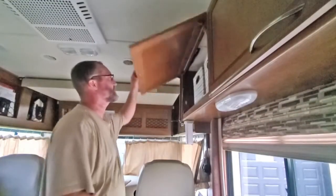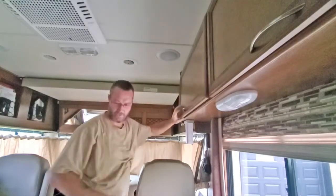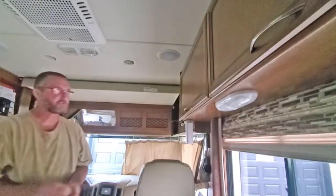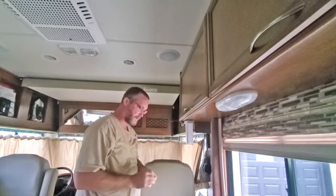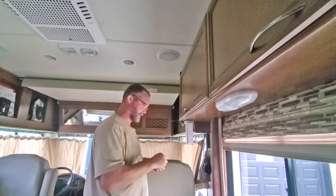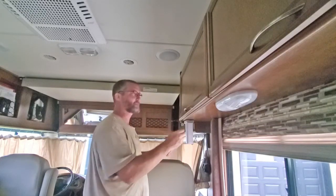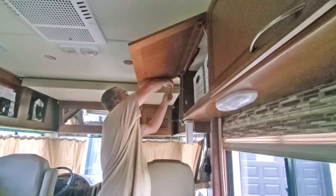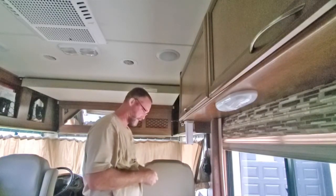This one should be relatively easy. This piston — the pop rivet came out of there. I don't think I'm going to pop rivet it; I'm going to use a nut and a bolt. I've got a couple of sizes to try out, but I'm probably going to go to the hardware store and get a different one — I want one with a nylon nut. Nylon nuts won't unscrew; they'll stay in place and not back out. I've also got two nuts for each screw so I can set it up like a jam nut where you jam the two nuts together to keep it from backing out. But just to be sure, I'll get a true nylon nut for it.